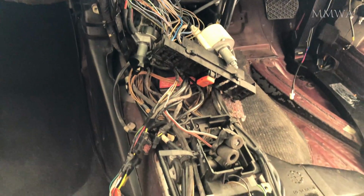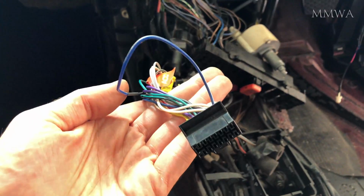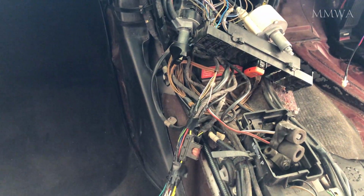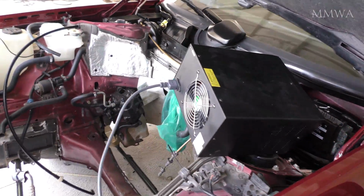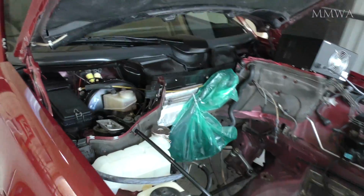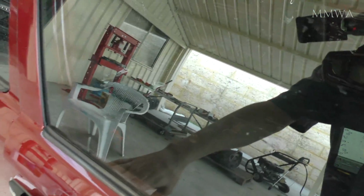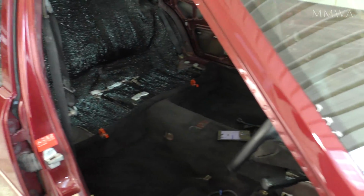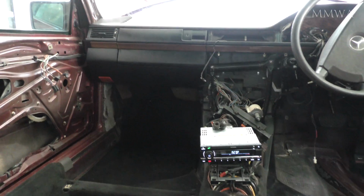It was then time to correct the butchered radio harness. Although I'm not actually that unhappy with this job, they did actually solder the connections. It's just I don't like the use of insulation tape. All connections I make use heat shrink, and then I bundle the cables together with my cloth tape, so it looks much nicer. So this is a demo of the set.